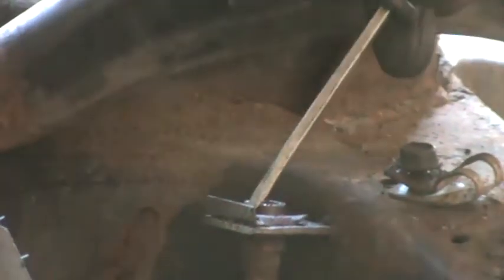And because they were frozen on there, the easy way to get them is to just cut that off and get the 6-point socket on them and take it off. And then again, remember there's a clip holding the brake line in. So there'll be a screwdriver, a trusty dead blow hammer. We'll knock that off, and that line will be disconnected except for the caliper.